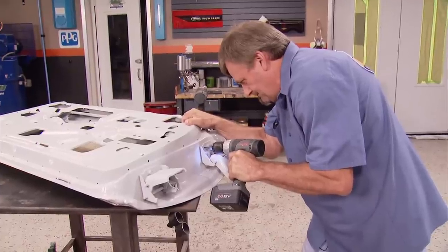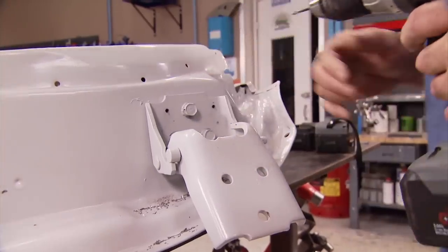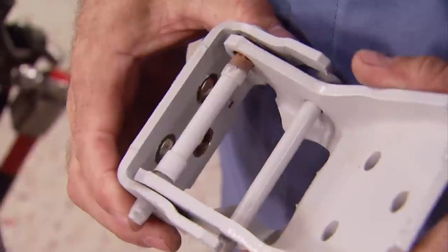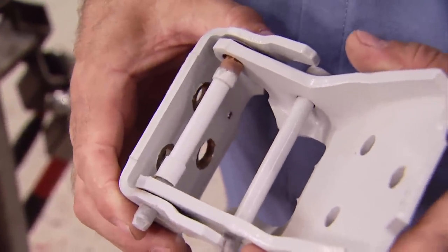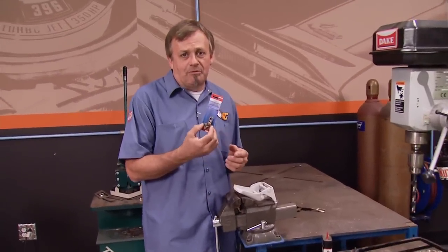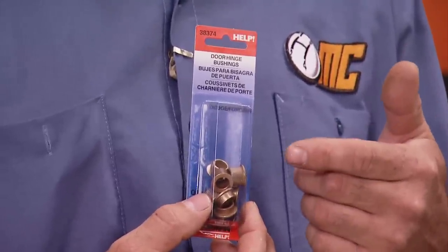With this technique, bigger is definitely not better. An eighth-inch drill bit is more than big enough — don't knock a three-quarter inch hole in it. You can see how wore out it is, it's pretty bad. What we're going to do to tighten up these hinges is install a set of Dorman bushings that we got from Summit Racing. This kit is universal and has enough different bushings for most older domestic applications. Summit also carries complete kits that have the hinge pins in them, but ours are in good enough shape — we think we'll be good to go with just the bushings.